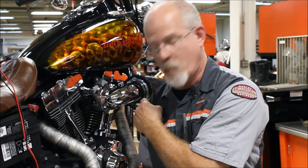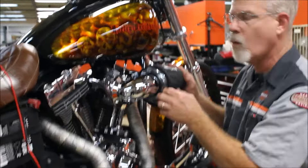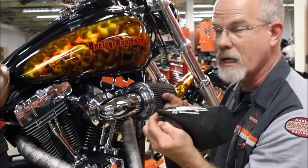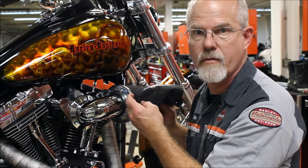That takes care of checking the engine oil. Let's check our air cleaner. This gentleman has opted for the high-performance air cleaner, so it's easy to check. I take the rain sock off — that's needed on these if you get caught in the rain. Rain likes to be sucked up into it and the rain sock really works, so I keep this on me if I'm riding. You can keep it on 24/7 if you'd like.